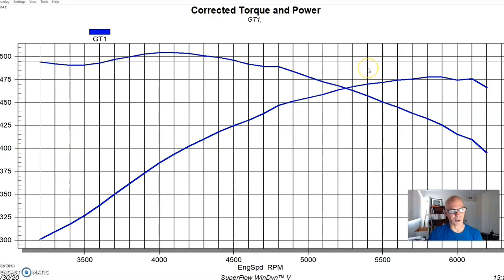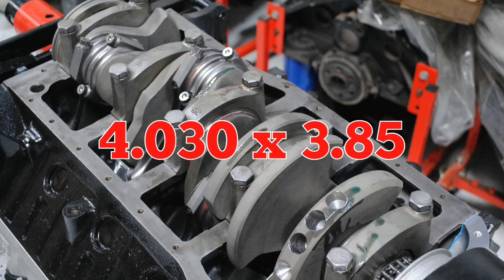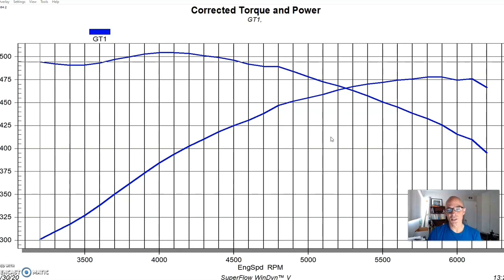We used it so much that we eventually hurt it — I think doing a blower or something. This was more than a decade ago. We had to bore it 40-over instead of 30-over, which is how it came, because this 392 was originally a stroked 351 Windsor. It had a 3.85-inch stroker crank. As it came from the Ford Racing crate motor it was about 9.7:1 compression with a 4.030 bore, but because we hurt it we put a 4.040 bore in it with a forged piston with valve reliefs, and compression was only slightly higher from the displacement change.